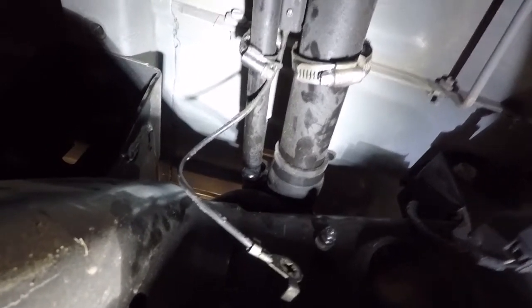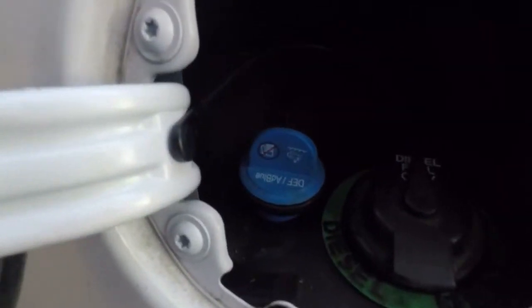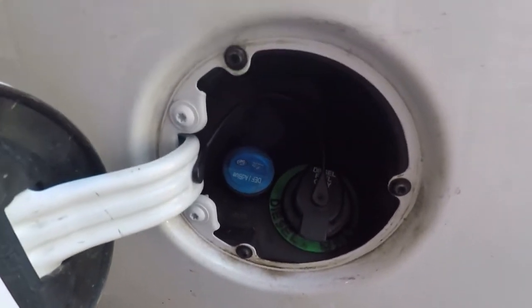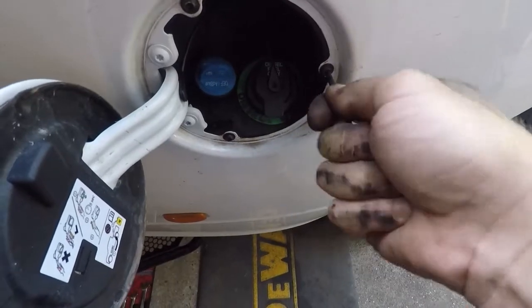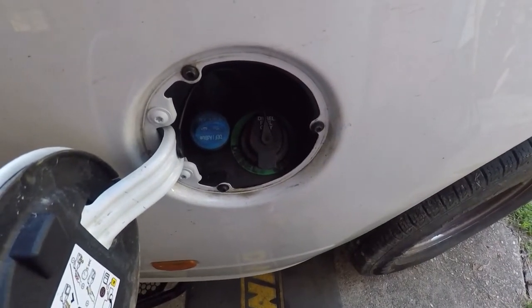And then the vent hose comes off pretty easy because it doesn't have much engagement, but the fill hose has quite a bit, so that one could take a little bit of finagling once we loosen up the top. So now we're going to pop out the bolts on the outside and see where we go. Again, we've got 3 Torx screws. Not much there. Seems to be all that's holding that in, so we're going to go find the right bit, zip those off, and see what happens. All right, so they seem to be T25s, so we're going to pop those off.